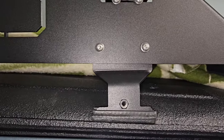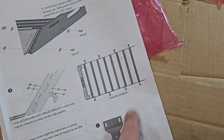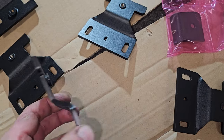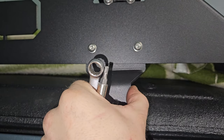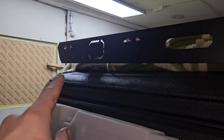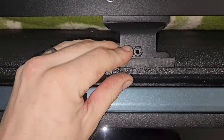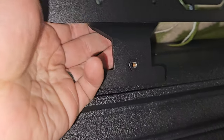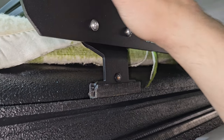The only thing I'm going to do on these clamps is put a little bit of rubber U-channel so it doesn't scratch up the drip rails. They've got markings — A, D, D, A — so they must be different because the Cherokee drip rails are actually curved. They're pretty easy to put on and they're also slotted at the back so you can adjust the height. I guess at the end of this I can figure out how low profile I want this rack to be, which is kind of nice. They're all loose but they're all sitting inside the drip rail pretty nicely. This one might need the spacer the instructions mentioned — you can see on that drip rail it would be hanging over, but with the spacer it's now in the central point of the drip rail.